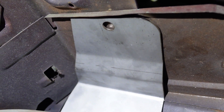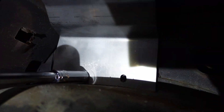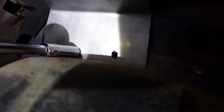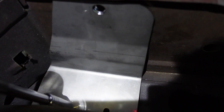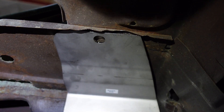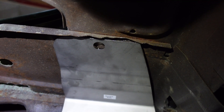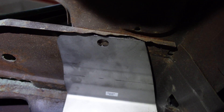I got that one bolted in - now I need to drill a hole there and one up there as well. Got the hole in the top plate but it needs to be a little larger. I'll take the plate off first so I don't damage it. That hole lines up perfectly - I put a bolt through it and it fit. On the driver's side I had to bend the flange a bit - anyone watching my channel knows this car was hit on the left rear, so that's probably why it didn't quite fit. Nothing to do with the kit, just my car being slightly off.